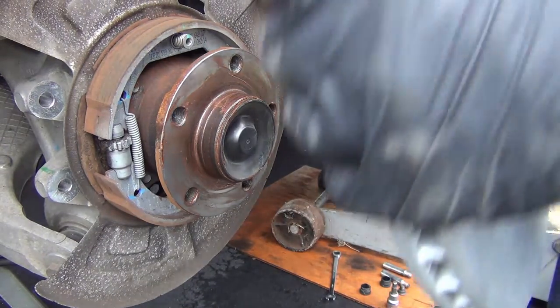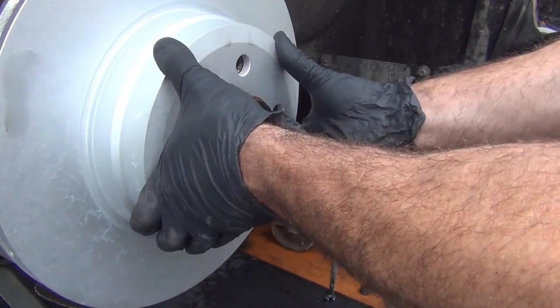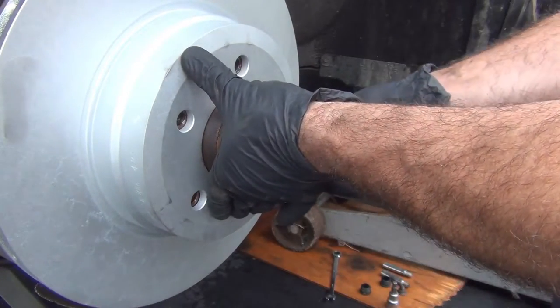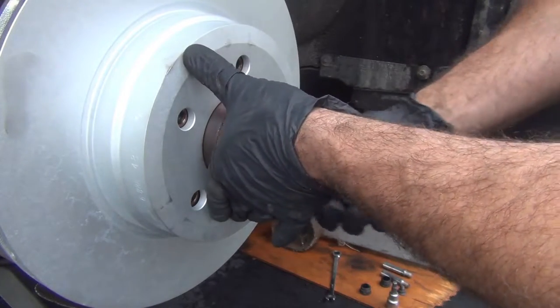Just put a little bit of lube on here — this is just anti-seize. I don't need to have it be thick, just a light layer. So next time I do a brake job on this car, this will come right off for me. I'm going to install my new rotor — a little wiggle and it'll mate. This locator screw is 16 newton meters.